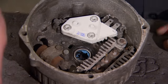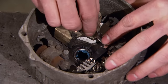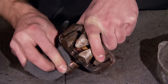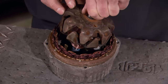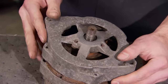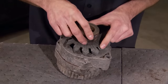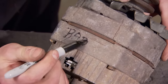During reassembly, make sure all the original hardware goes back in the correct location — these are small fasteners that don't require a lot of torque. Before installing the rotor assembly, use a gray scuff pad to clean up the surface of the slip rings so the brushes make good, clean contact. When putting this thing back together, it pays off big time to keep track of the parts and the order in which they were removed. And lastly, don't forget to pull the pin — because just like a grenade, this thing would be rather ineffective if we didn't.